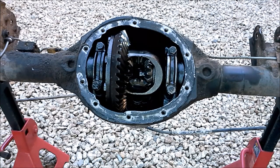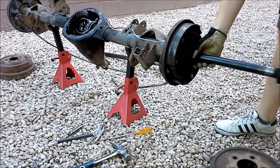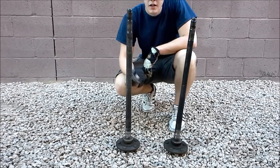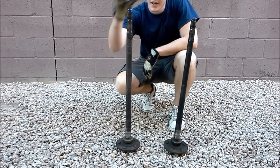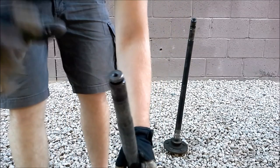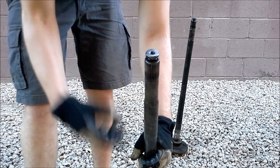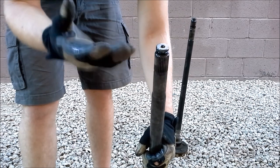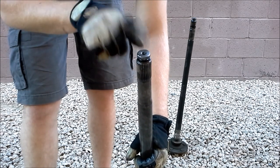Now I'll start off on the left side — I can slide the axle shaft out. Here it is. And here's the other side coming out. Once you pull out those C-clips, the axle shafts just slide right out. This one's from the driver side and this one's from the passenger side — this one's a little bit longer. The C-clip clips inside of this narrowed-down part of the axle and that holds it in place. Right here are the axle shaft splines — these ones are 27-spline axle shafts.